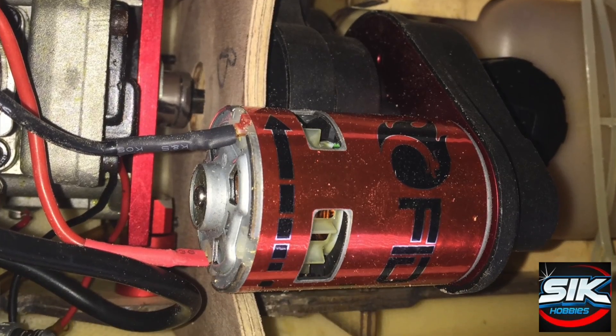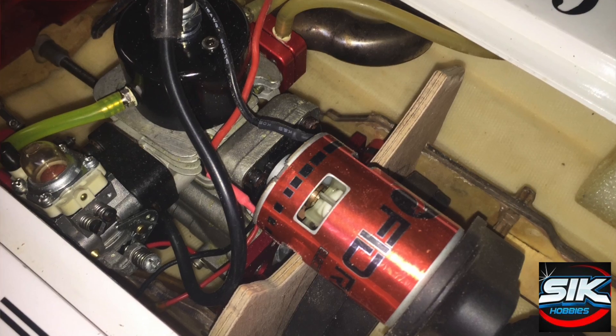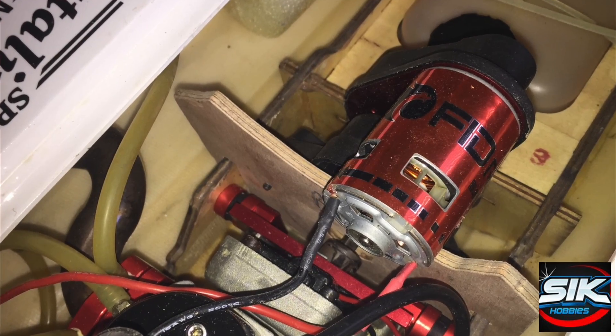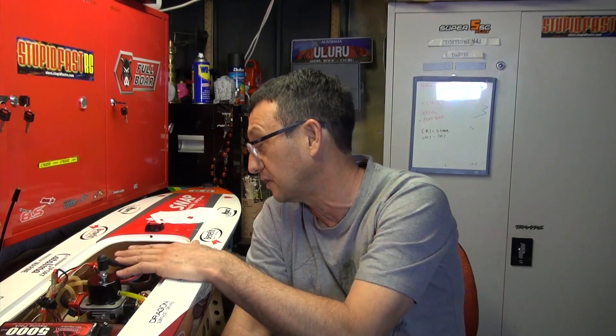It then slotted in very nicely into the front of the motor. There was originally a 12mm socket on the front of the starter motor — I had to change that to a 14mm. Interesting thing about quarter-inch drive sockets is that they only normally go up to 13mm, so I had to buy a tool kit that actually went up to 14mm. Then I was able to change the front of this so I could actually fit it all on.